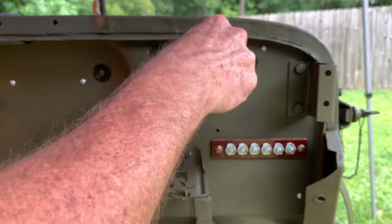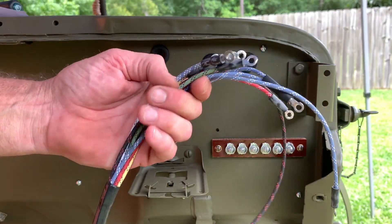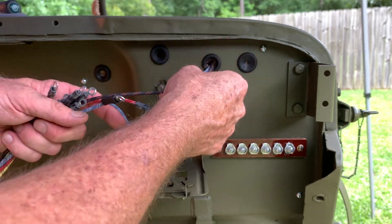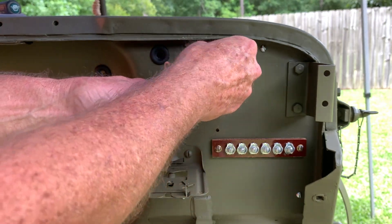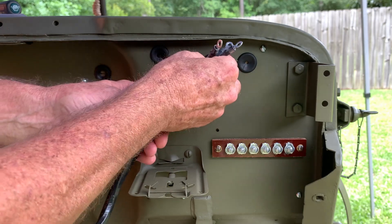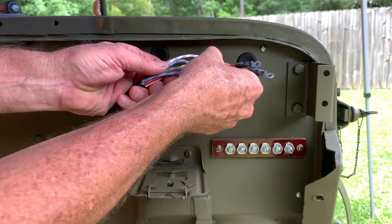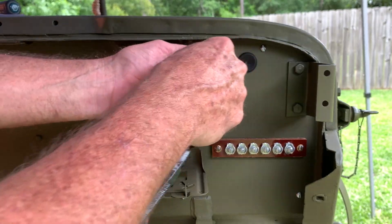The location for the long harness will be the second hole in from the driver's side. Use a screwdriver to punch through the firewall pad — it'll be easier than trying to push the wires through directly. Feed one wire at a time through the grommet, starting with the longest one first and working to the shorter ones. Feed these wires all through the grommet and push them so they come outside of the dashboard. That'll make it easy to wire up the switch before it is installed, since there's not much room underneath the cowl to work once the switch is in.